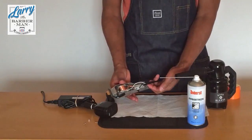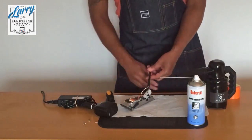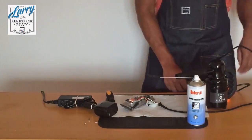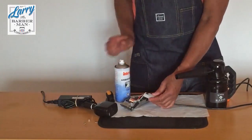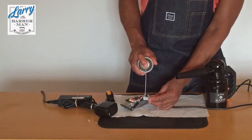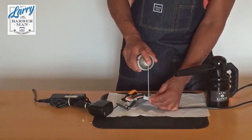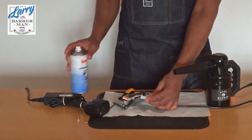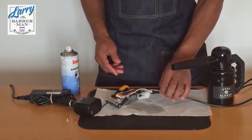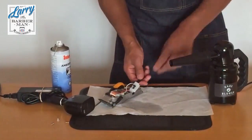To get to the switch you simply take out the cable and get to the switch. Ensure that the machine is switched off — at the moment I'm disconnected from any electrical power. You use the straw, take it, and basically put the straw in the switch and give it a quick blast. Then switch the switch to the other side and again give it another blast with the alcohol. Since it's alcohol it will pretty much dry up, so just give it a shake to get rid of the excessive fluid.